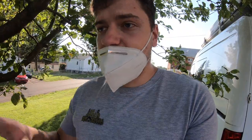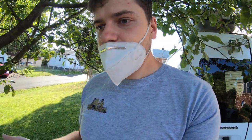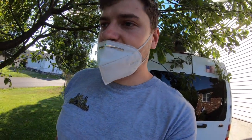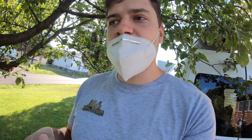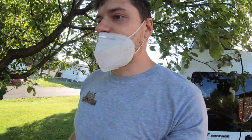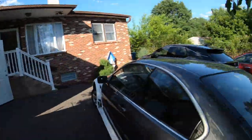I kind of made it work. I put one layer on and smoothed it out. This is not the finished product — I'm going to put another layer. I'm actually going to buy really good Bondo from AutoZone or order something online instead of getting a kit that was probably sitting on the shelf too long. I'll show you my first coat. I sprayed it already with primer, which I wouldn't recommend doing on the first coat — put more coats on before you primer. I had to do this because it's going to be raining and I don't want the bare metal to start rusting. I kind of just hit it to see how it's gonna look, and I'm really happy with it. It looks really good. This is only the first coat — I'm still going to apply probably two more coats of Bondo.